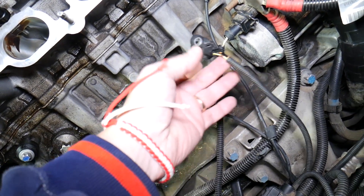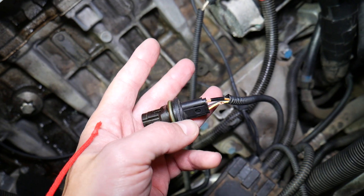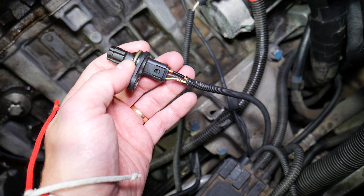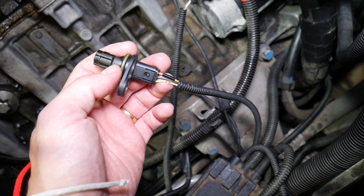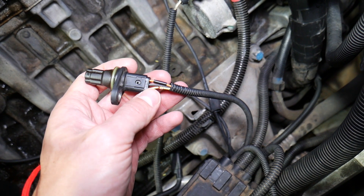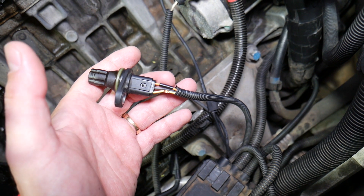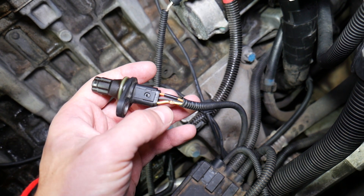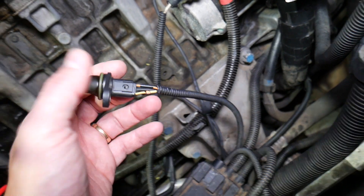This is the sensor itself. The sensor consists of three wires. There is a black wire in the middle — which is usually the ground wire. It may be black and white or black and purple in different cars, but it's a little thinner than the other ones and that's your ground wire. Then you have two more wires: one is the ignition wire, where the voltage corresponds to battery voltage once the ignition is turned on, and the other is the signal wire, which will have about 5 volts.